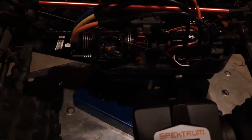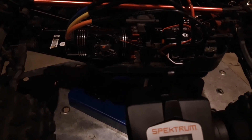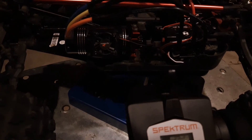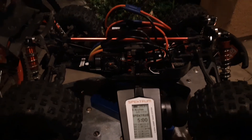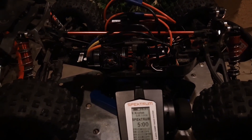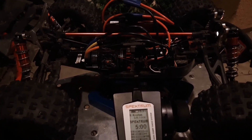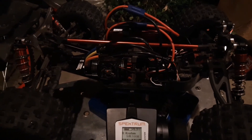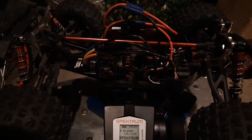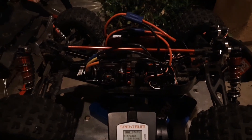I'm on a 19 tooth pinion with a 1730 KV, the big motor. I'm probably going to start it off on punch level 3 or 4 and just test the waters and go from there. But yeah, there's my new motor swap - I just wanted to show you guys. I'm going to mess around with some programming and let my thread locker set. The only thing I have left to troubleshoot is go to the hobby shop and have them figure out what's up with that one screw in my motor mount. But as far as that, it's working perfect. You guys have a wonderful night - I can't wait to drive this thing in the morning. Have a good night YouTube, take care.